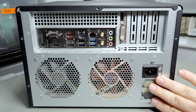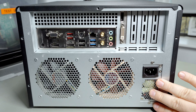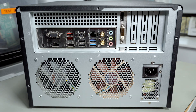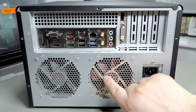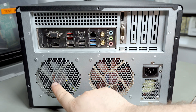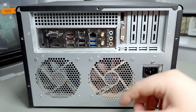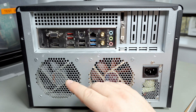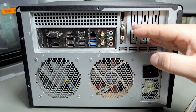Round back there's a Flex ATX power supply — most of these cases only use Flex ATX, you're not really going to find any that use SFX or ATX power supplies. It's just the nature of the OEM that made these. This particular one has dual 92mm fans. I had to pull one out and put it in a server, but it has two 92mm fans and four slots because it's an MATX board.